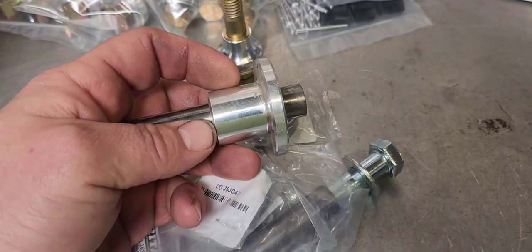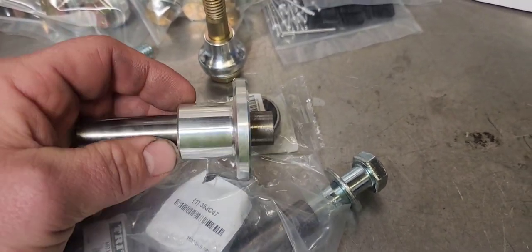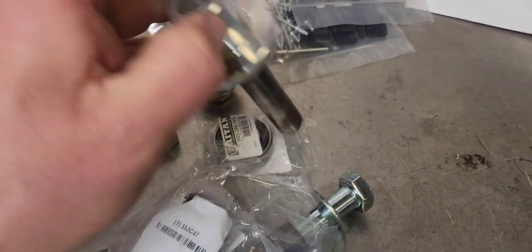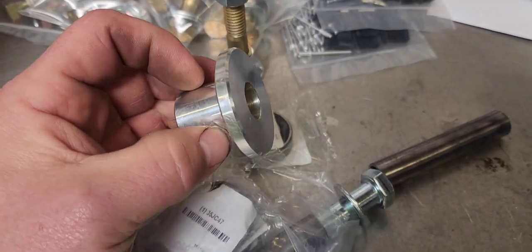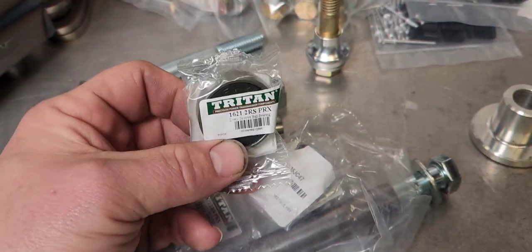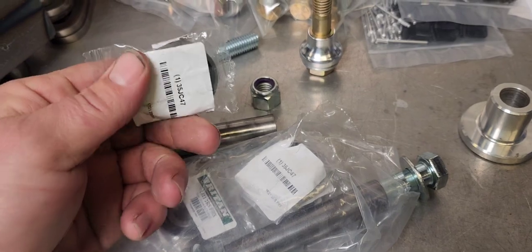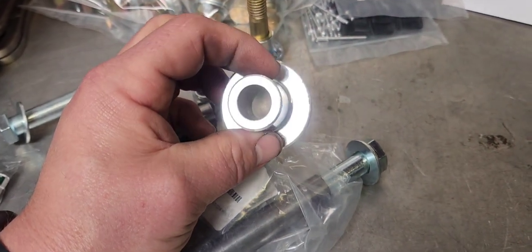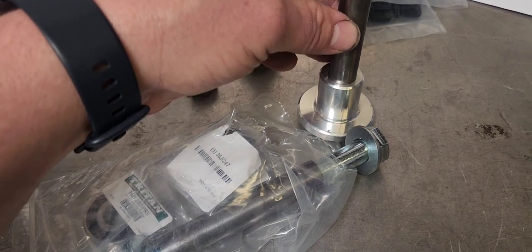The axle's only purpose is to hold the bearings apart. You'll notice that when you slide it through the bushing it fits really nicely — there's actually almost a little bit of clearance. But after we get done pressing the bushing in, this sleeve is not going to slide through there anymore, because the deformation from the spring eyelets squeezing the bushing down makes that hole smaller than it was supplied. These bearings I get from Grainger — the part number is right there if you need to replace them; I also stock them.